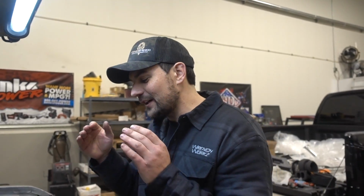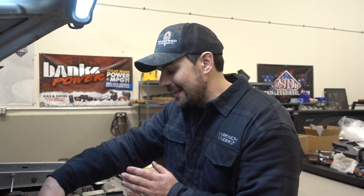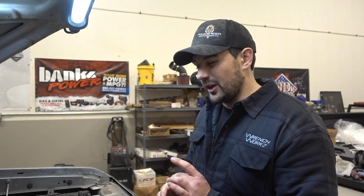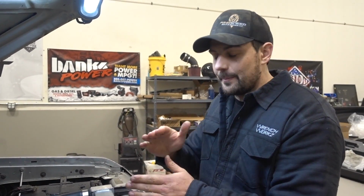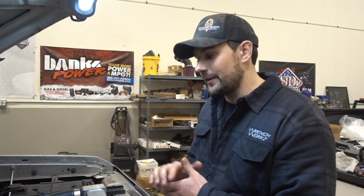As far as other engine modifications, we do have a Keating Machine front cover on this thing, and an adjustable pump gear that's inside of here. Trying to think of other internal modifications. We've got a Hamilton cam in this thing, Manton valve train. Other than that, the bottom end is completely stock. We did actually pull the head off, if you guys remember. We've had this thing for quite a while, so I'm trying to remember all this as we go.